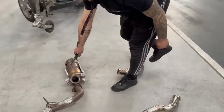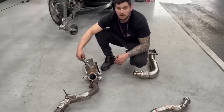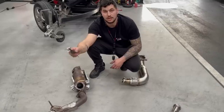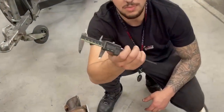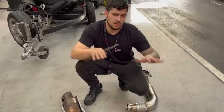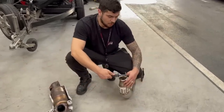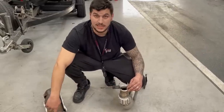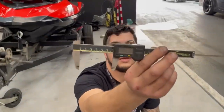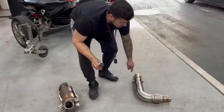Here at the outlet of the tube — in this case, at the outlet of the original catalytic converter — we have a measurement of 55mm. Original: 55mm. This is so no one can say the diameters of the lines are different. With the original line and the performance line made by us, there are no doubts. After the downpipe, where it was 55, we now have 60mm.